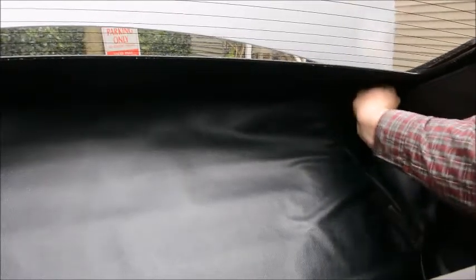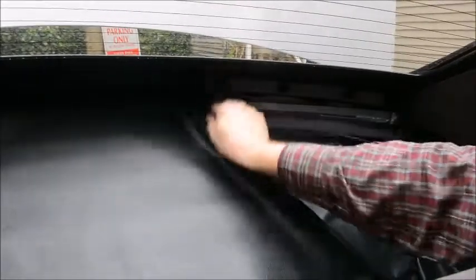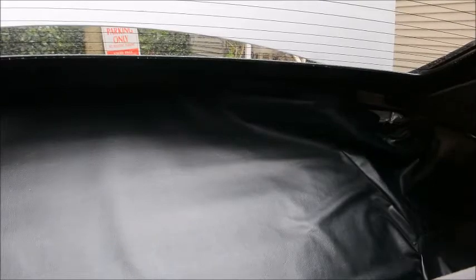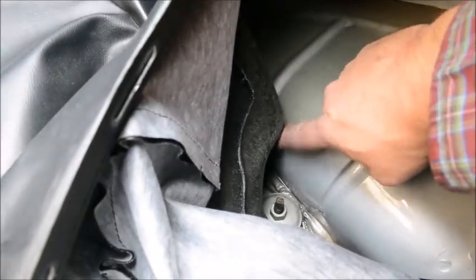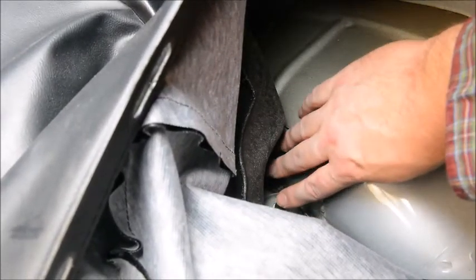We just want to gently pull off this little plastic trim and pull it away from the nuts around the perimeter of the cover. When you pull up this cover and look down you'll be able to see the nuts for the top. So we're right by the wheel well here, and this is the material I just pulled back from the convertible boot area. You can see that is the top nut of the shock — this is the nut we're going to remove to free the top of the shock.